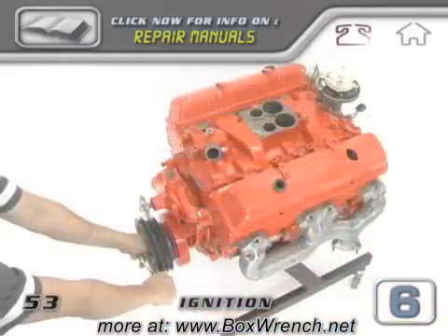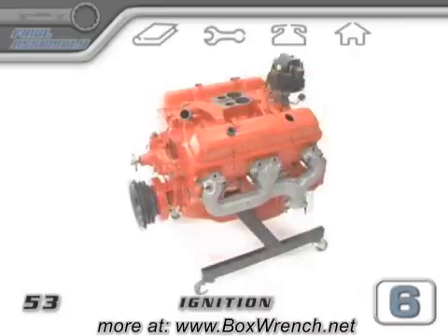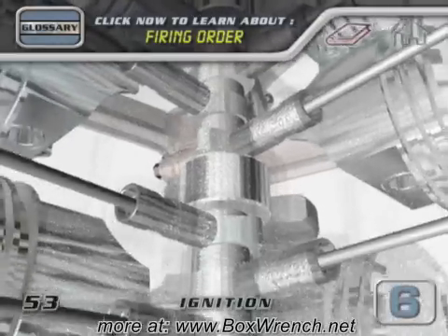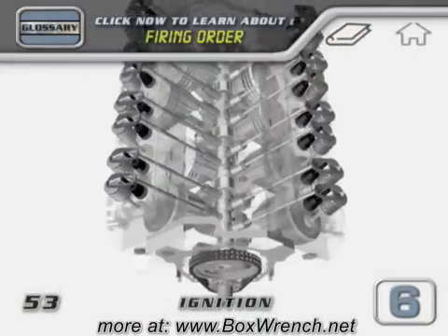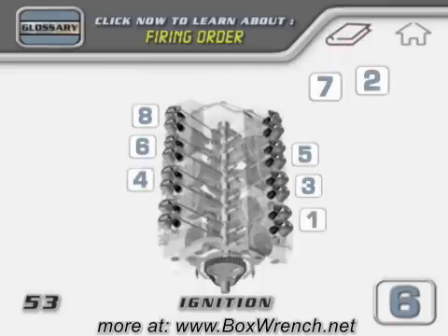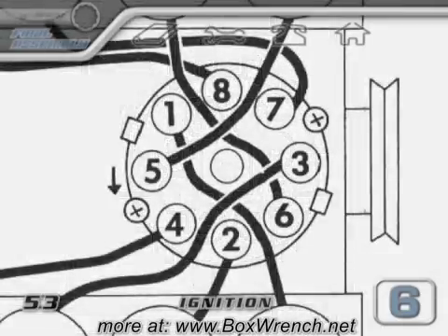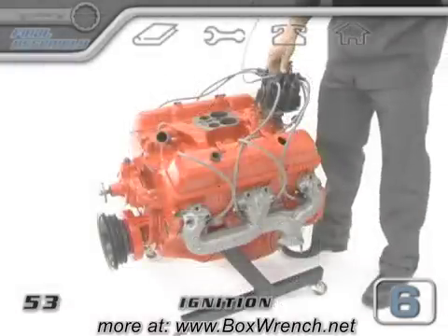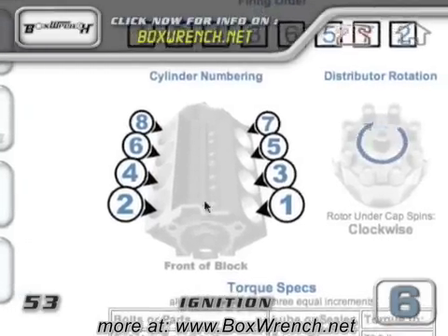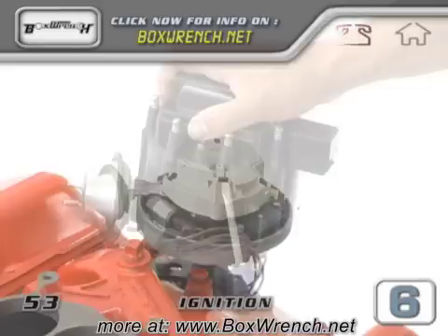Okay, we're looking good. The crank is positioned and the distributor rotor is parked at the moment of ignition for the number one cylinder. Now take a look at your firing order. Every firing order for every engine type starts with number one, and then the rest of the numbers in the sequence follow the valve opening events of the camshaft. Your engine absolutely has to match this sequence or it's not going to run. You might have seen a diagram for your plug wires in your repair manual — these diagrams are just a representation and you don't have to follow them exactly. To correctly wire any distributor, all you need is three pieces of information: your cylinder numbering, the direction that your distributor rotates, and your engine's firing order. We already have the rotor inside the distributor set in place.